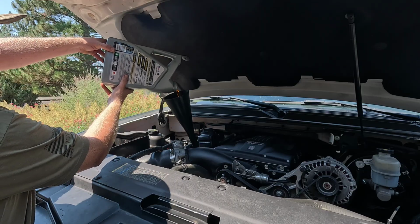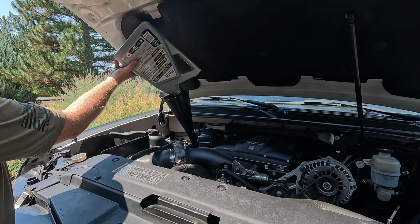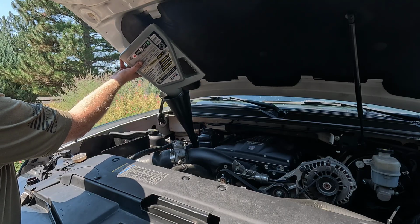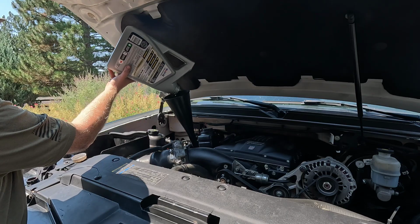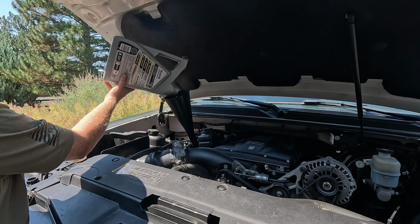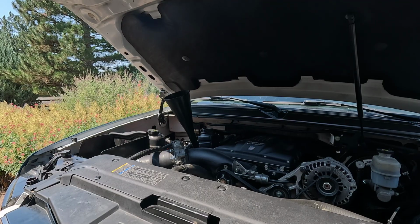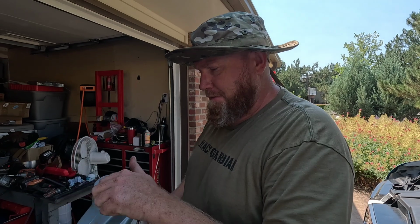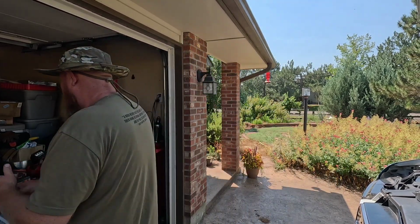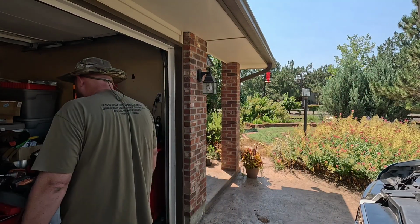It's a little more expensive, but I like it, if nothing else because it's easier to use. Plus, I use nothing but full synthetic in my good stuff, I guess in my fuel injected stuff. In my old stuff, not so much. All my Internationals are just going to end up running 15W-40 anyways. Old motor, the extra additives work better for them anyways. Some utility usually.